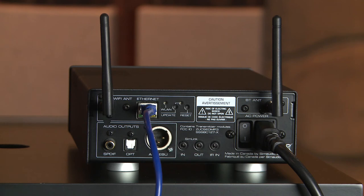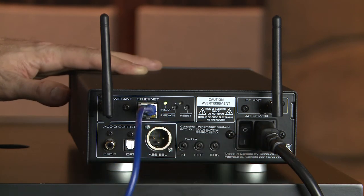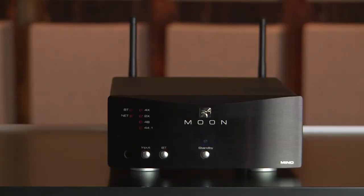It's very important to wait for the router to reboot completely before powering on the MIND. Remember this: when you power on the MIND, it will look once for an ethernet connection. If nothing is found, it will then look for a wireless network, if one was configured in the first place. So a "MIND not found" may very well mean that the network has lost it.